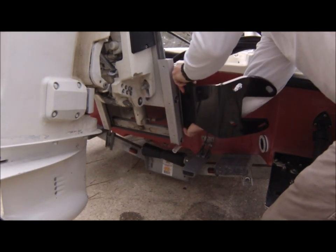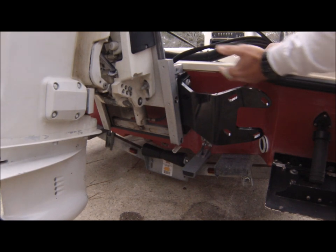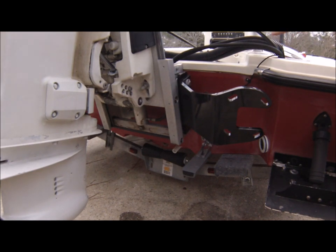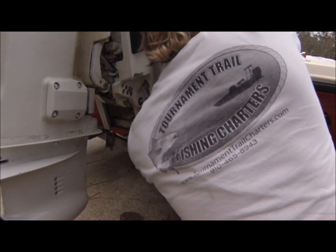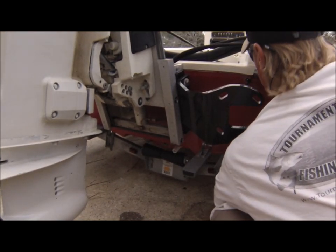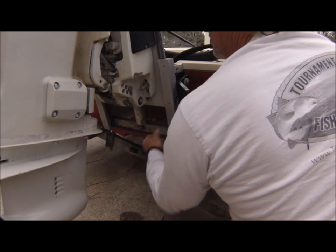Both bolts should go in pretty easy. I'll leave the top one out a little bit because the transom bolts that attach the jack plate to the transom are kind of in the way on my top bolt, so I'm just going to leave it barely in there. Then I'm going to put the washer and nut on that top bolt first. The best way to access it is to go under the jack plate with the jack plate all the way up — put your washer on there, barely fit it on, and then come right behind it with your nut. Then I'll do the bottom bolt — put the washer and nut on the inside of the jack plate. That one's way easier to get to.